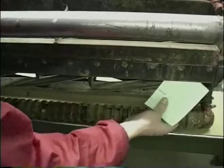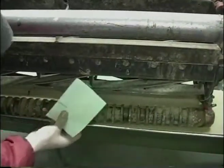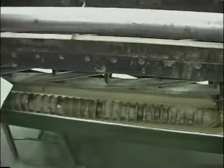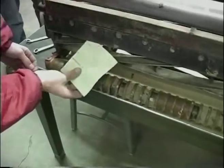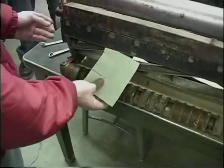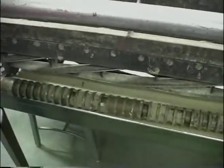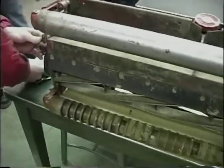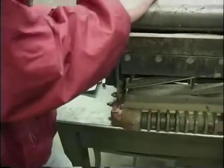Vinny there. Contact in there. So it's contacting 3/4 of the way down, but not at this end. So he's almost parallel, but not quite. So you still need to move the bed knife which direction? We'll go down just a, I mean, you're talking just half a flat or one flat, not very far.